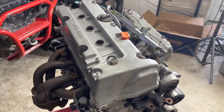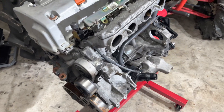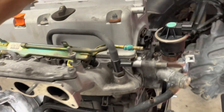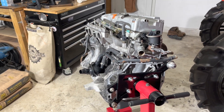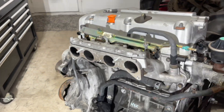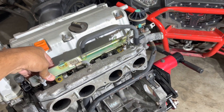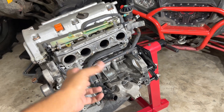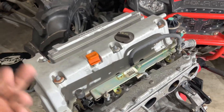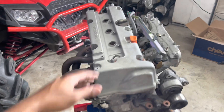All righty guys. As you can see, this is the motor my dad gave me. It's all stock — all the accessories were taken off when it was swapped. Hopefully it's nothing too crazy, maybe the head gasket's bad. This is a K24A4 motor. These motors come in the Honda Elements, some Accords — it's pretty much the weak K24 motor. But she's doing good on mine; I'm running like 12–15 PSI. Let's go ahead and open this bad boy up and see how the internals are.